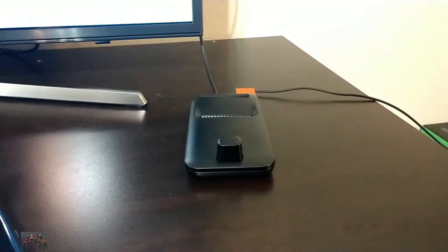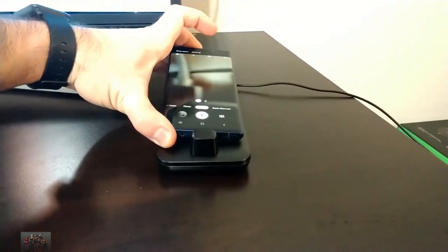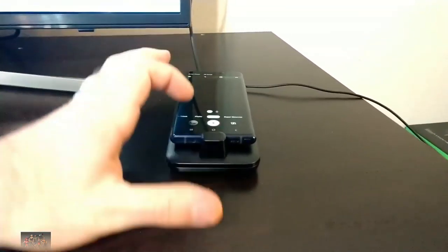So guys, in order to get this to work, you're going to need a few things. The first thing being a phone that supports screen mirroring out over HDMI. Screen mirroring can also be used wirelessly, but I didn't have a good experience with that — it was a little laggy. So you're going to want a phone that supports HDMI screen mirroring over USB-C. I'm using the Samsung DeX dock and it works perfectly, but in DeX mode it doesn't work, so you have to switch to screen mirroring mode on your phone.